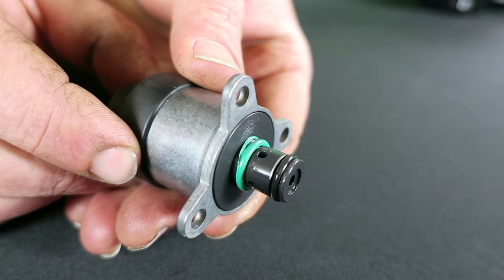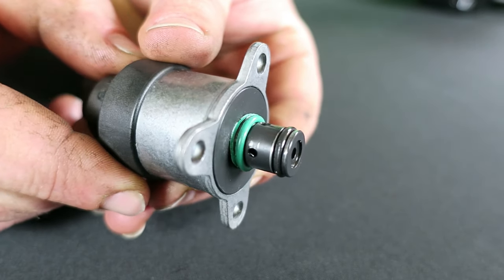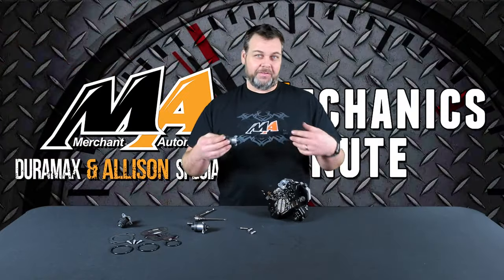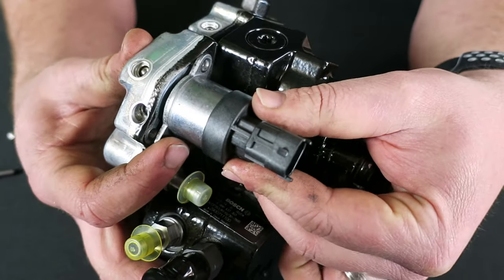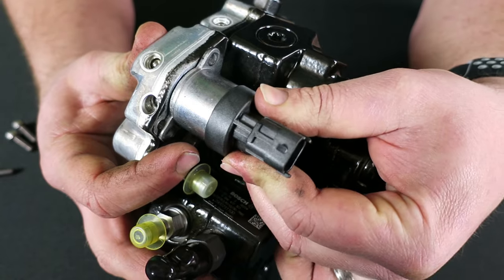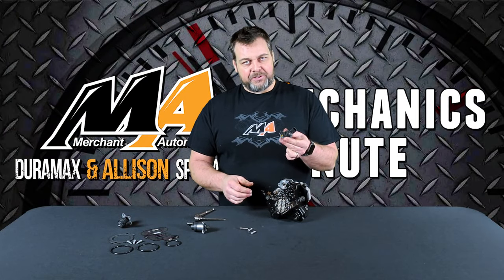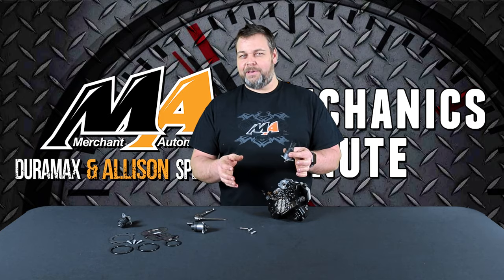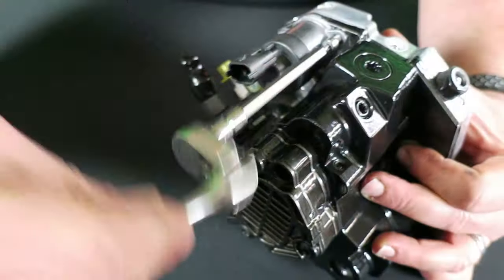So you've got a brand new regulator you've just put in, the o-rings get damaged, you get the truck together, and now your problems are still there or you've got another situation — maybe it might not even start. A lot of times it's because the o-ring got damaged going in. These regulators are right straight from Bosch; this is not a cheap aftermarket copy, so I have very high confidence in the regulator itself not being the issue.